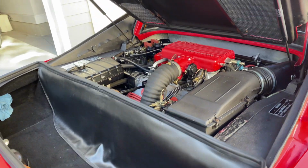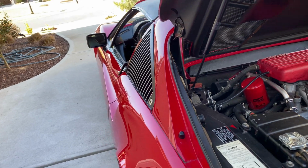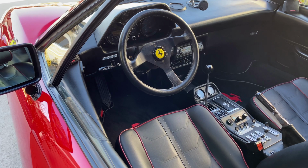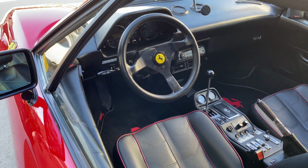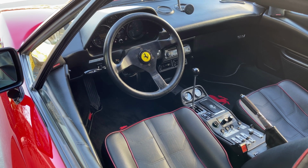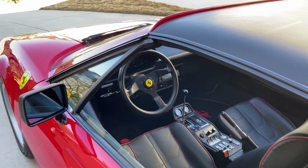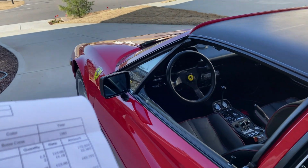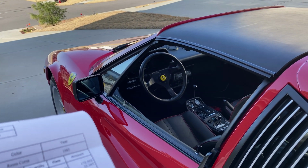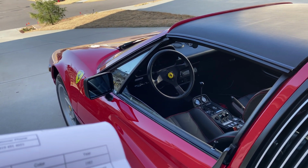They also removed the instrument panel and replaced the dash light bulbs. It was pretty dim at night, so it was very hard for me to see the cluster when driving. The radiator fan was not working. I think there was an issue with the fuse box, so they removed the fuse box. They rewired the radiator circuit and repaired a whole number of wire connections in there. So that was good, and they changed out a number of fuses.